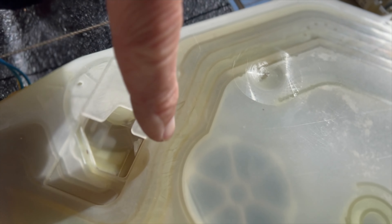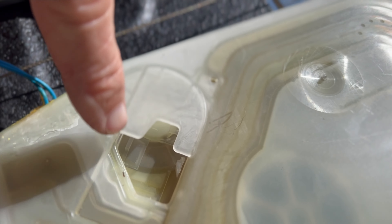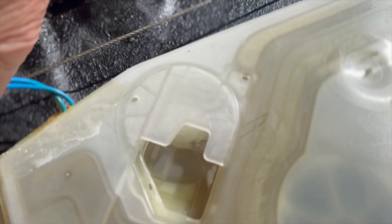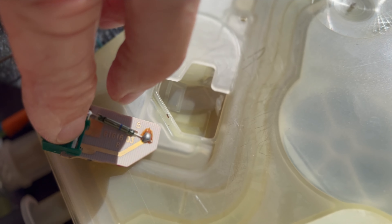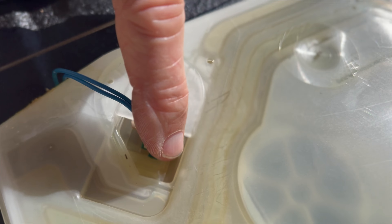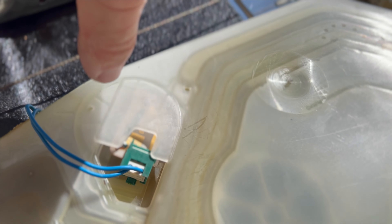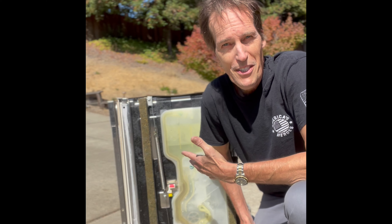Sometimes you can free it up and get it moving — once it's moving, you're okay. But usually in my experience the wheel does move and the problem is a loose wire connection or corrosion that just needs to be cleaned. Sometimes this part has just burned out and no longer does its job. So: first clean and redo that connection, next try replacing that piece, and lastly — which is very rare — use a powerful earth magnet to turn the stuck wheel.